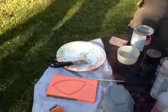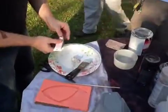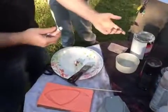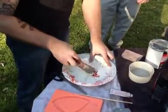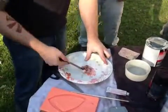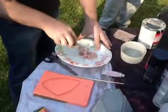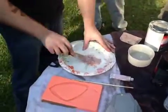It's a little bit more complicated than the plastic and stuff, but only because you don't mix as much. It's not a one-to-one thing. And it's got the instructions on here, like for a golf ball size of Bondo, you only want a couple of drops or something, but usually I'll just put however much down and then put a line of the hardener through it. And this is real easy to tell when it's mixed nicely, because you've got the white Bondo and then the red hardener, so when everything is that nice solid pink color, then it's ready to go on.